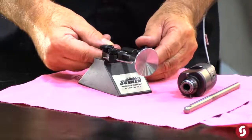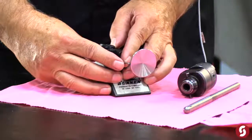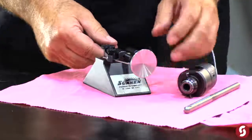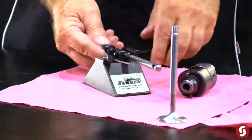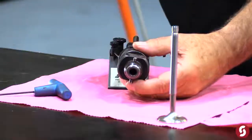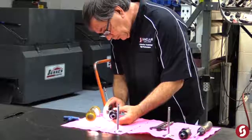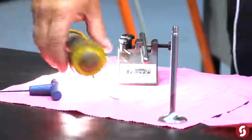What Jim's doing here is he's setting up our valve seat cutting tool fixture. The tool cutting bits we'll be using are a multi-angle approach to the exhaust and intake valve seats, which maximizes cylinder flow and the contact patch area on the valve. It's very precise and has to be done exactly correct to optimize the flow of the cylinder head. As soon as he gets done with the setup, he'll get over to the bench and start cutting some seats.